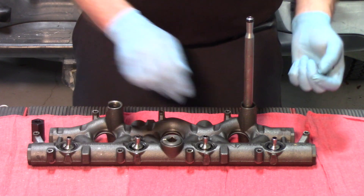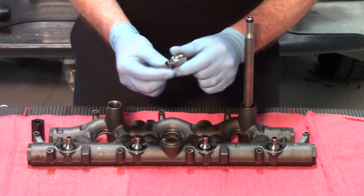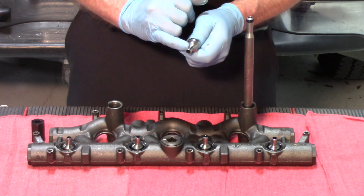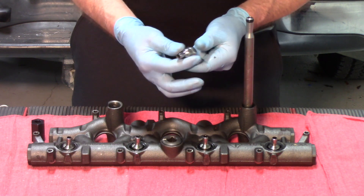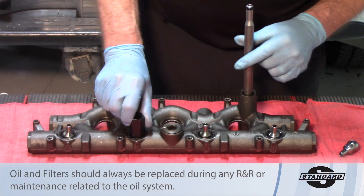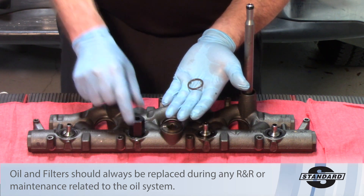It's a pretty easy process. O-rings are sold in a set of four. The ball tubes are also sold individually. However, being a hardened steel, they're not a real high wear item. Occasionally, because of grit buildup in the top of the injector — if somebody hasn't changed the oil regularly — it could cause a scar on the seat and you may want to replace the ball tube. But normally, simply wiping them down with a rag and making sure they're clean, using the special socket you can go in, remove the retaining nut, and out comes the ball tube and the O-ring that resides inside.